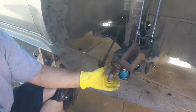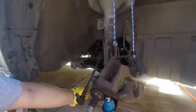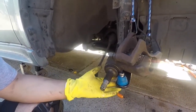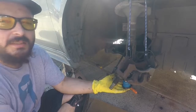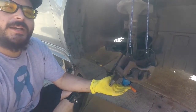Arms on, none of the bolts are on yet. What I'm going to do is put the bolts on, make sure I thread them in almost all the way, but I'm not going to tighten it because I need to put the rest of the knuckle on. Anytime you replace a lower arm like this, you want to tighten down the bolts and torque them down when the car's at ride height.